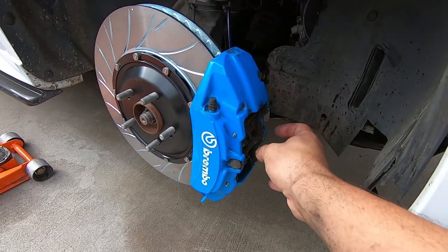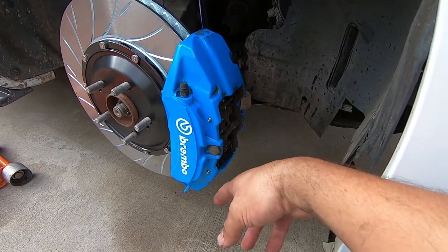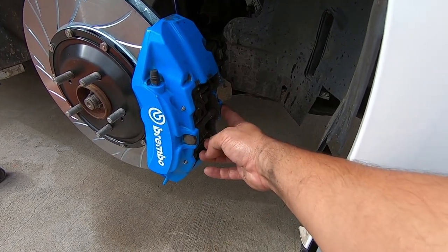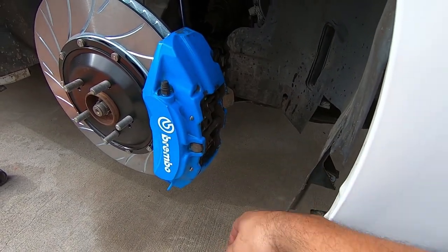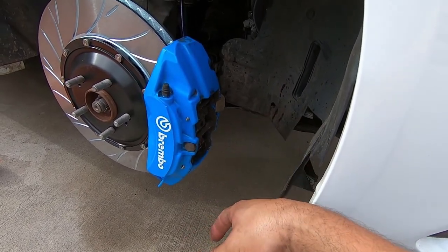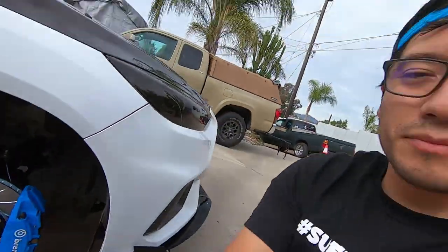So there are different options for you, and it's still relatively easy to change out the brakes by pushing out these two pins, undoing the center bridge bolt, and then out they come. Just make sure you have a caliper tool to compress your pistons afterwards. So huge benefits there. We're gonna throw the wheels on and show you the bedding in process. Pretty simple, but we're gonna show you anyway.